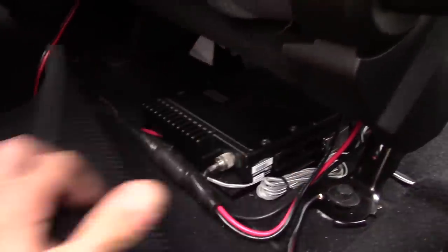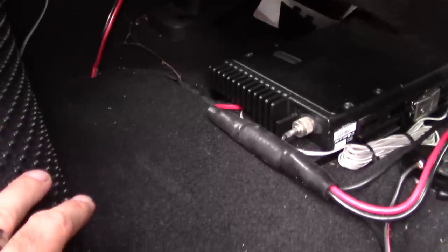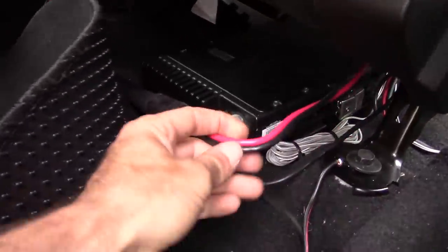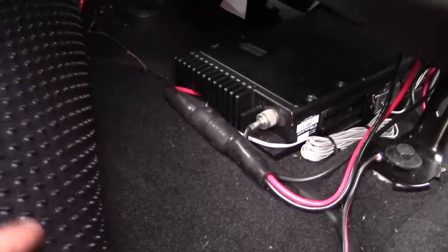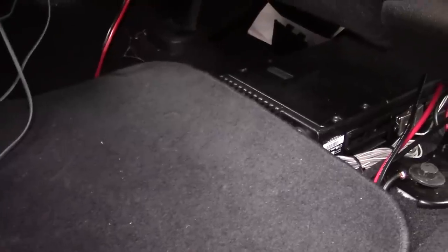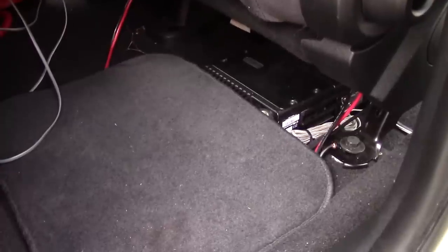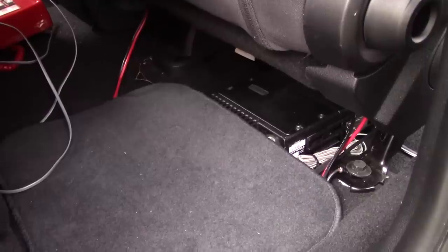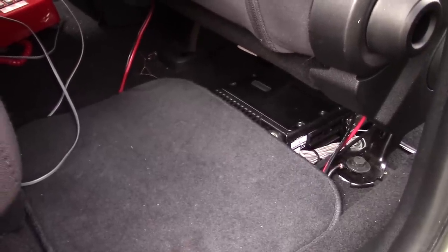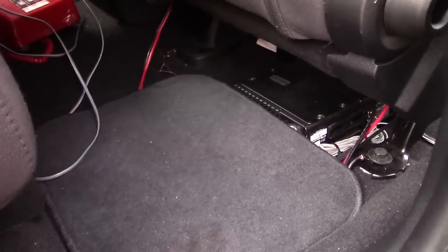When you run your power wire, what you're going to want to do — look at the back of this radio. This is actually a big ferrite, which cuts out the alternator noise. Here's your power wire and ground going in. That goes to the back of the radio — ferrite beads take out the alternator noise. There are noise isolators and some different options for that, but on HF and CB it's really bad unless you have a solution like that. Make sure you have good noise isolation to take out the alternator whine so it doesn't blank out — and sometimes it'll transmit that over the air too, so people will hear it and say, oh, you must be driving, I hear your alternator.